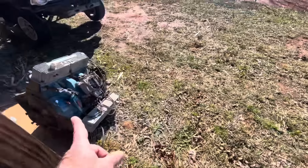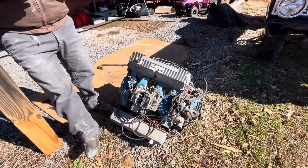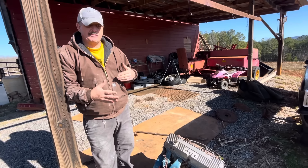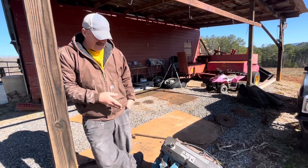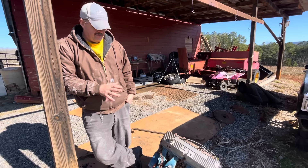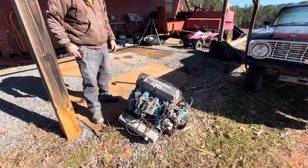That intake is a 427 Edelbrock — F427 Edelbrock. That intake manifold was copied off the Ford police interceptor 427 Sidewinder intake. Really great intake. From when they started building it in the early '70s until Edelbrock started building the Performer RPM, there was no better single-four dual-plane intake built. With a little mild port work it flows as good as the modern intake.